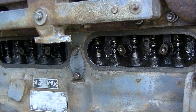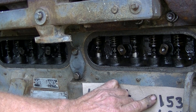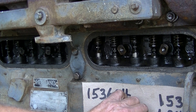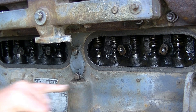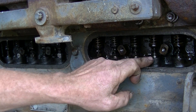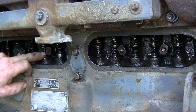So we had number six rocking and set number one. Now we move to the next one in the firing order — number two in normal rotation. When we see number two rocking, we can set number five in the same manner. You can see the exhaust valve closing on number two cylinder, and that other lifter right here is just starting to open. So with number two rocking, number five is the running mate and we can set it — both are free, which confirms it's correct.